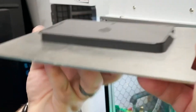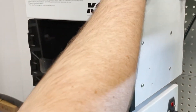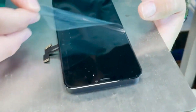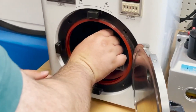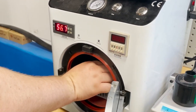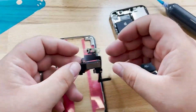One of the other big deterrents is the investment in the tools required for the next steps: a laminator and an autoclave — typically very expensive. But the nice thing about the current market is there are cheaper and cheaper machines that can accomplish this task. A laminator will laminate the layer of glass using the OCA to the display and gets 95% of the way there. As you can see, after the laminator is done there are still bubbles under the display, and that's where the autoclave comes into play. It puts an immense amount of pressure on the display, forcing the bubbles to squeeze out from the layers. Once that is done, if everything's been done properly, there should be a clean lamination with no dust or debris under it — due to the glass being installed in a clean environment — and no bubbles left under the glass.